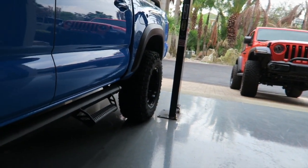To run this 285-70R17 setup, you have to have at least three and a half inches of lift in the front. As it turned out, my 3-2 lift actually came out to three and a half inches in the front and two inches in the back. You don't really need to worry about the back — unless you have a gigantic tire, it won't rub since the rear doesn't turn. If you're going to an aftermarket shop, get it in writing that it will not rub. If they're not willing to commit to that, walk away.